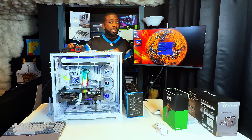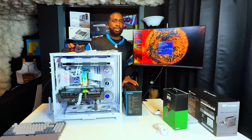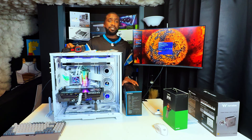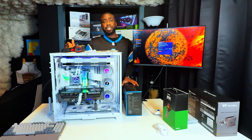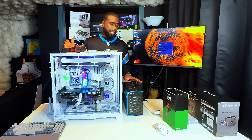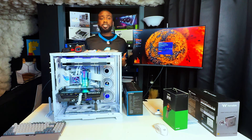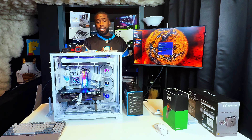I never go directly at the recommended power supply wattage. If you give yourself a little extra headroom, you're probably going to be better safe than sorry. If you're willing to spend two thousand dollars-plus on a graphics card, that extra $150 to $200 for a bigger power supply is worth it. You'll be able to make that decision based on your situation — I'm just bringing you this information to help.